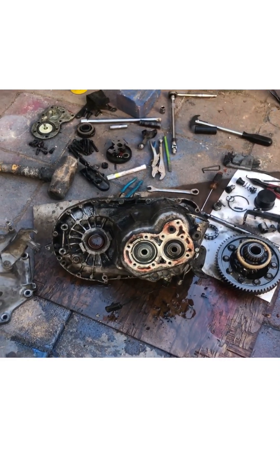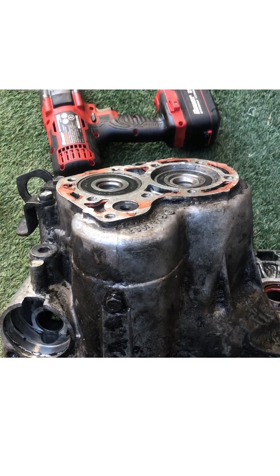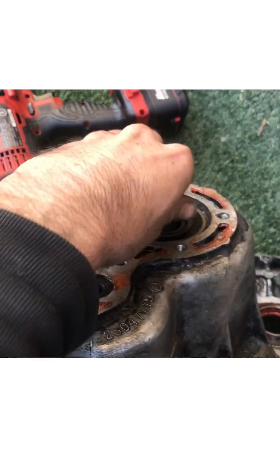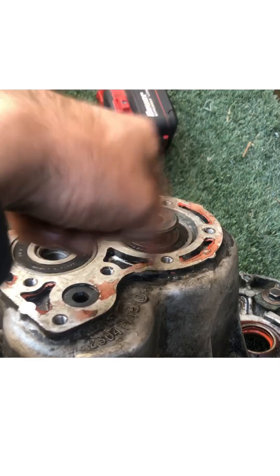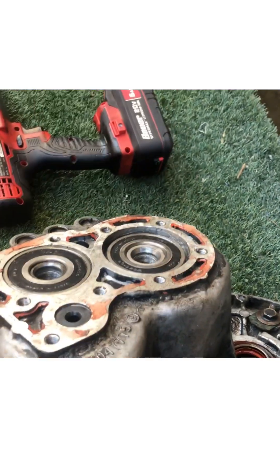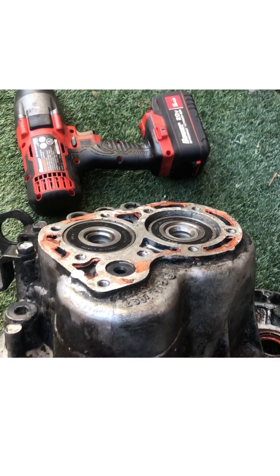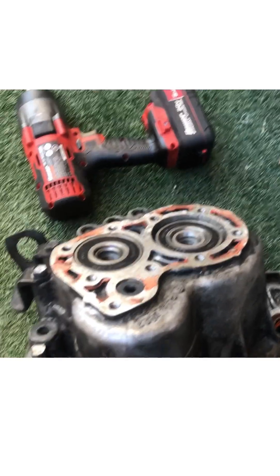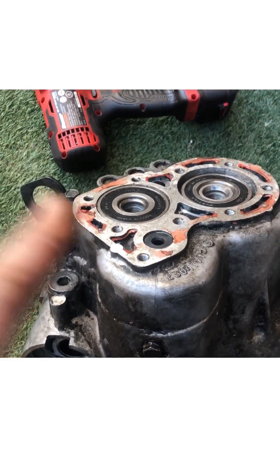After more investigation, I finally figured out how to get the shafts out. There are actually bearing retainers. The larger one is reverse rotation — it threads in counterclockwise, so you tighten to pull it out. The small one is regular rotation. I found that information in my 1988 service manual; the other manual I was using didn't show it. Now I think the gear assembly is finally going to come out of the case.